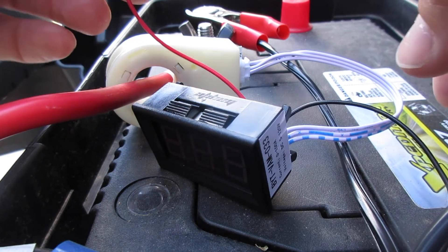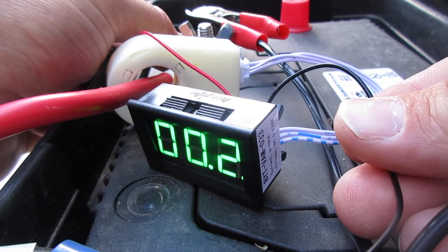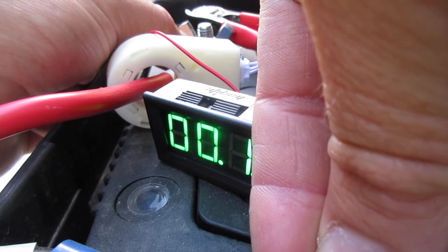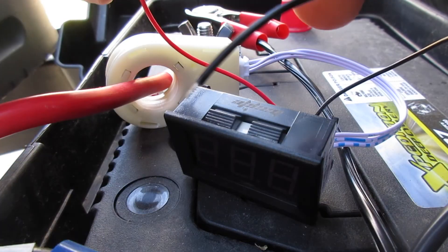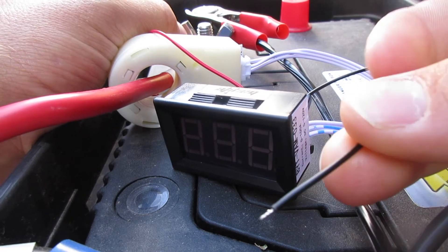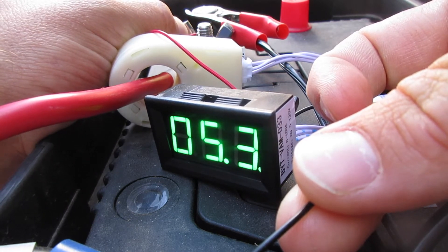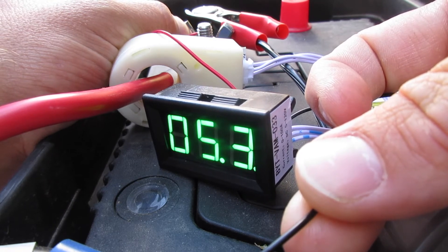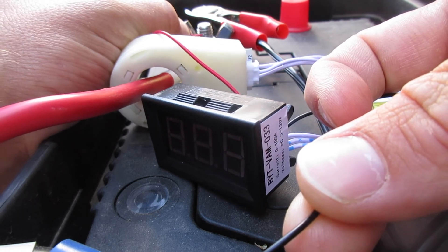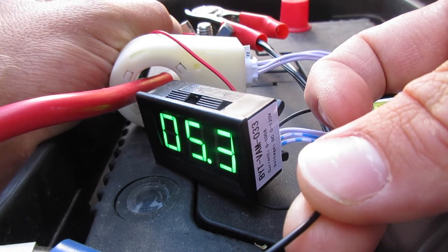That was actually with two USB fans on and the main cabin lights on. I turned all that off and now we're at 0.2, 0.1 amps. Now that I have main cabin lights on, two fans on, the awning lights on, and the slide lights on, we are drawing 5.3 amps. And I look down at the charge controller and we are putting in 5.7 amps. So theoretically, we're still putting in more than we're using, if I'm understanding this correctly.